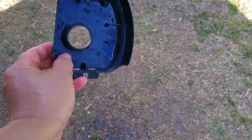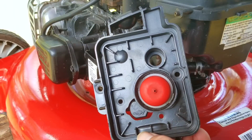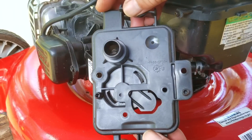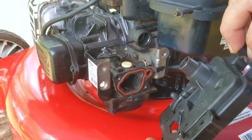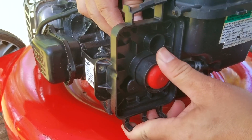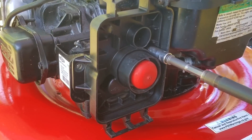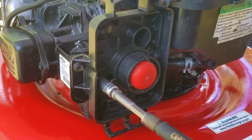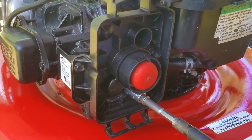What's another creative fix I've seen besides duct tape and zip ties? Most people will never get to the level of doing metal work, but it's not out of the question. The most common questionable fix I've seen has to do with the fuel system, which is probably not the best place to improvise. What I've seen are fuel lines being replaced with other lines that are not fuel safe. I'll sometimes find aquarium air hoses being used for two-stroke machines, and one time I found a really strange fuel line on a Briggs mower — the only way I can describe it is that it looked like a miniature garden hose.